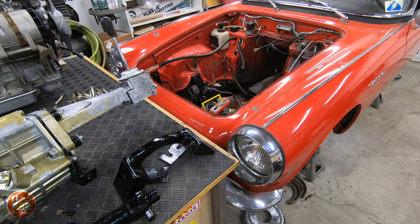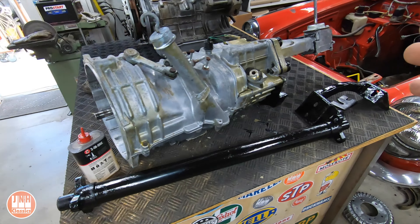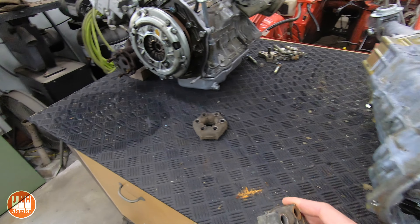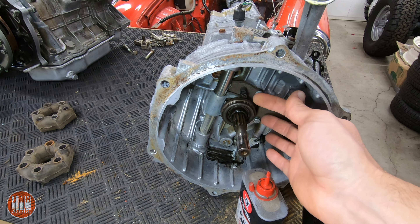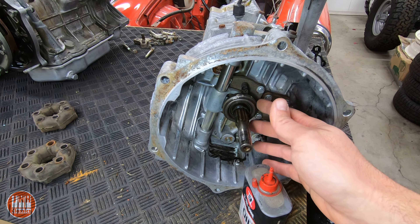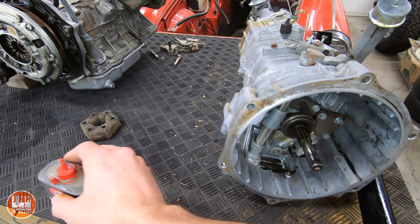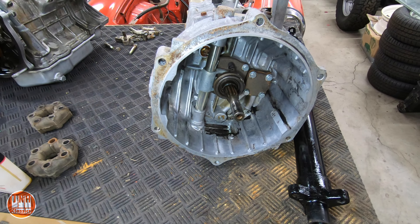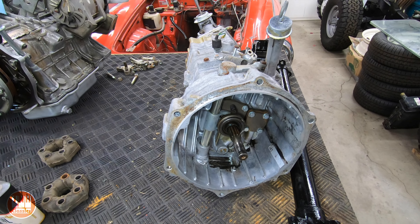On this car I'm really just waiting on parts — I put in my last order about two weeks ago and hopefully they'll show up really soon. What I'm waiting on is gaskets for the transmission, some main seals to replace before I put it back in, and rubber ends for the drive shaft. The main thing is this throwout bearing. When I first pulled the engine it was completely stuck and wouldn't turn at all. I cleaned it up with penetrating oil and brake cleaner, got it to spin, and greased it — it would probably be okay, but I went ahead and ordered a new one so I don't have to worry about it. I basically ordered every transmission seal they had, so when the parts arrive I'll find out what seals I actually have.